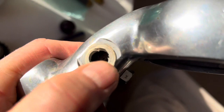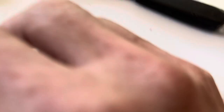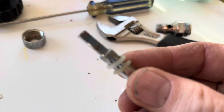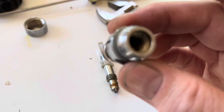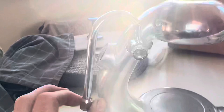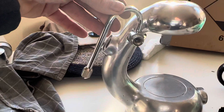There's another difference: the gasket on an Atomic would be a paper or cardboard gasket, whereas this is a silicon rubber gasket, and it's cut completely differently — that would be a hole going all the way through without these sharp edges. There are two silicon washers on there, whereas on the Atomic kit you'd get three washers and also a brass washer. The fitting on this replica uses a silicon gasket, whereas it would be a cardboard or paper gasket on an Atomic. The position of the steam arm is a matter of choice — not supposed to move once tightened. We'd normally have it vertical or tilted back slightly.